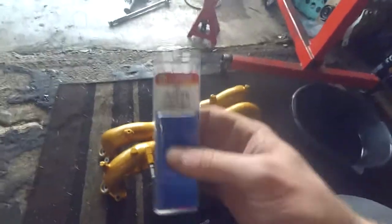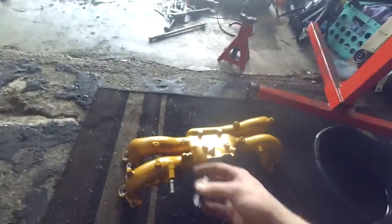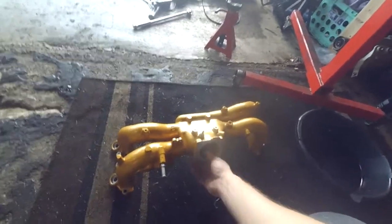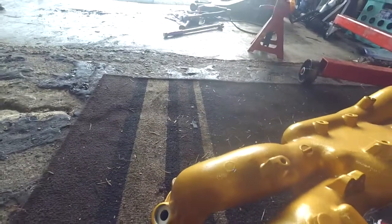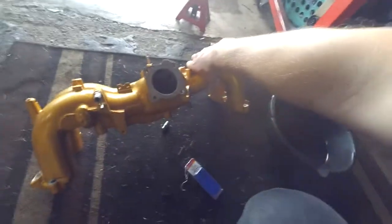So I just tapped this stuff. I went down to Napa and I got a 1/8 pipe thread tap - 1/8-27 NPT pipe tap. Really, if you're doing this yourself, you just gotta get one that matches whatever fittings you get. I went ahead and put one in right here where we drilled those holes, and one down there for the blowoff valve. I kind of messed up the paint a little bit, but it looks pretty good. It's airtight - I used some thread tape in there.